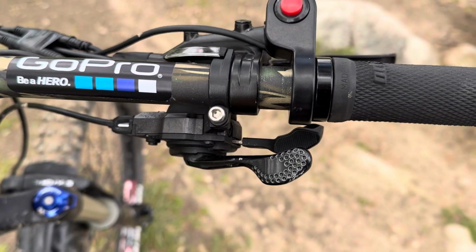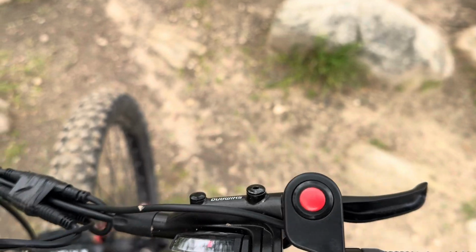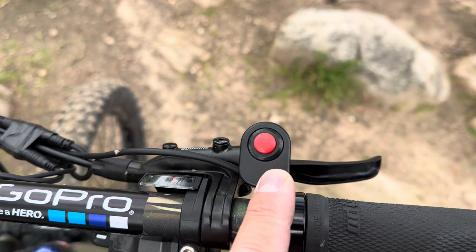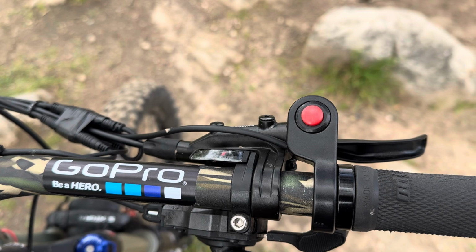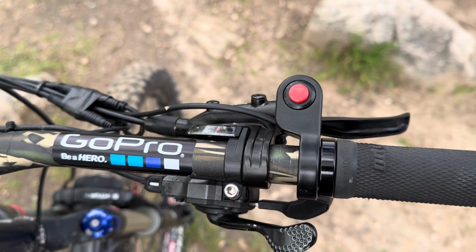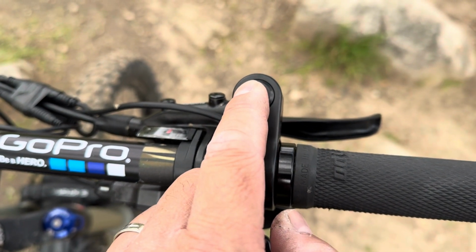On this side we have XT 11 speed and a kill switch for the motor that's plugged into one of the brake sensors. I don't use a brake sensor on this bike, but I felt like the kill switch was important because there were a couple times where the bike went over and the pedal started moving and the bike just kept on going. I guess you could probably just grab the cranks, but it looked like it was spinning pretty good, so hitting the kill switch button is probably a lot easier. Found this button on AliExpress, and I'll leave a link in the description.